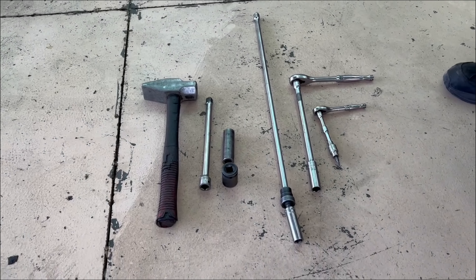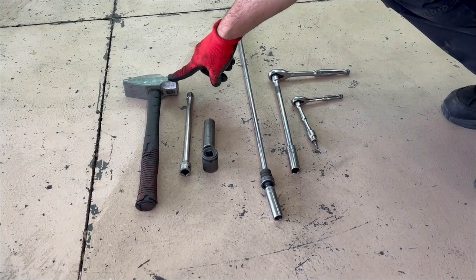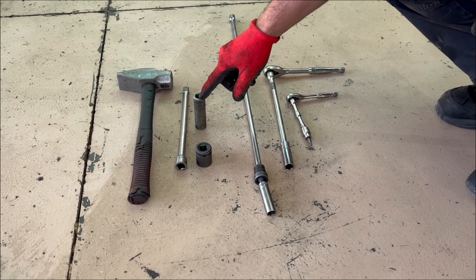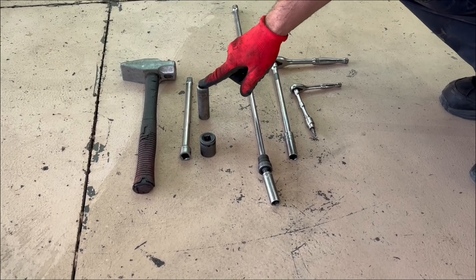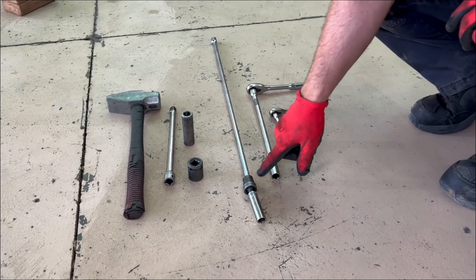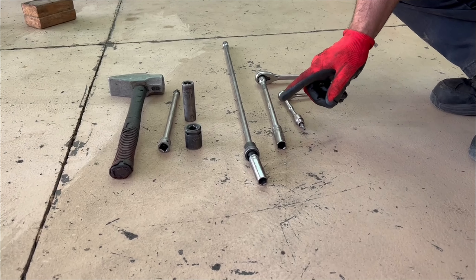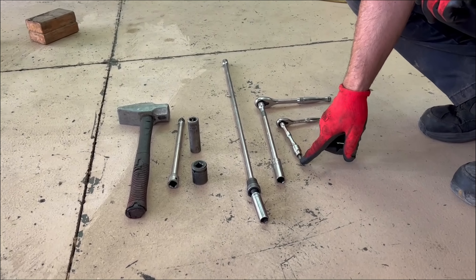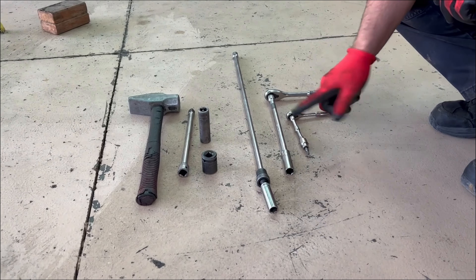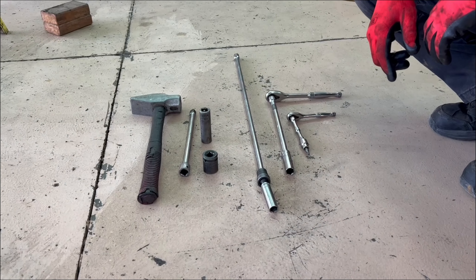We are prepping to lower down a subframe and we're going to talk about the tools you need. You want a hammer, a long 12-inch half-inch drive extension, a 9/16 socket, and a half-inch drive impact. Or you need an E18 — my E18 is not close to me, so we're going to use a 9/16 to get off the subframe bolts. We got a 21 millimeter. I have a long 3/8 extension, like a two-and-a-half footer, with a U-joint, an impact U-joint, and a 13 millimeter — that's for the motor mount bolts. For this car, because it has the steering joint mod on the rack, I needed a T25 and a 9/16 to loosen up the U-joint for the steering rack. If your car still has the rag joint, all you need is a 10 millimeter. That's everything — that's how we're going to get the subframe out.